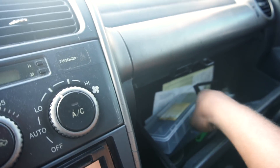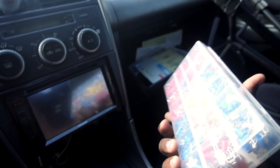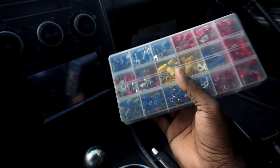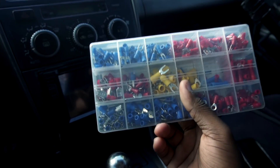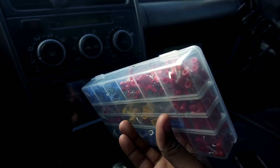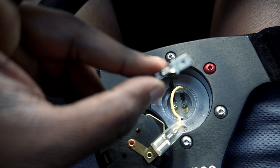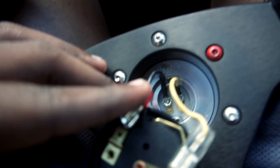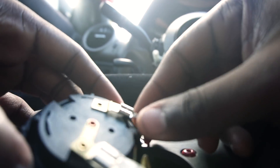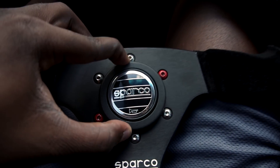That's why I have connectors on deck. My friend Nick made me buy a full connector kit for $14 when I could have just bought a small pack for five or six dollars, but they really come in handy because I use them for everything. So you're going to cut that black wire to get rid of the wrong piece and replace it with the correct connector, which you can then connect to the tab. Then you just pop your horn button back in.